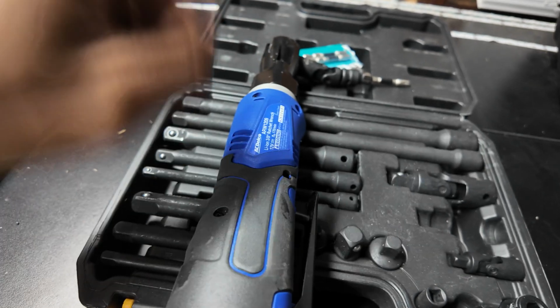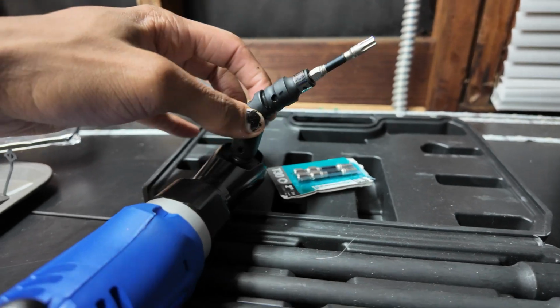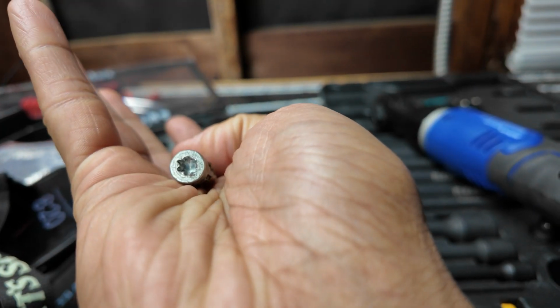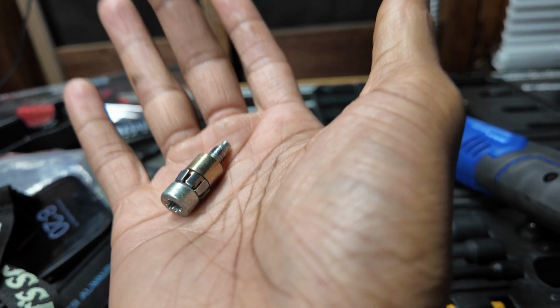I did buy this power ratchet, which definitely helps out a lot. And then also using a swivel attachment did help. And then if you are curious, this is what the actual airbag bolt looks like. So you can see that's where the T30 goes in. And it's kind of long, so it takes a minute for it to undo. So doing that part wasn't too bad.